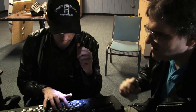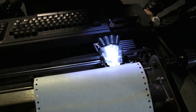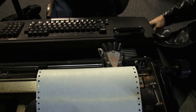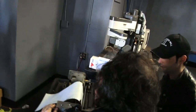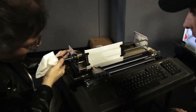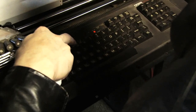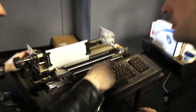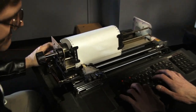Clear to send, online. You get a carriage return, not a line feed. You have to hit line feed to get a line feed. I'm going to go all the way back up here because you can't read anything anyway — we're printing at the top of the ribbon. Put the top of the paper at the top of the print head and hit setup, T-O-F, top of form. Now when you hit local form feed — bingo, a page! Hit line feed a couple of times; we're off the weak spot on the ribbon. Now if you type 'the quick brown fox jumps over the lazy dog' — good letter, yes.